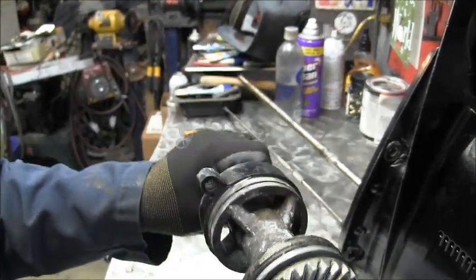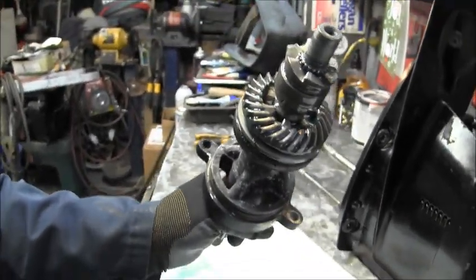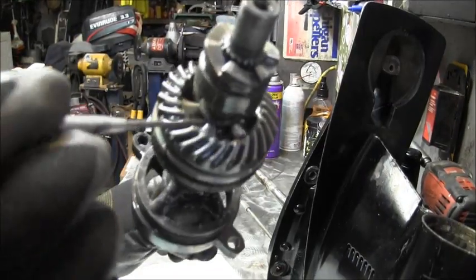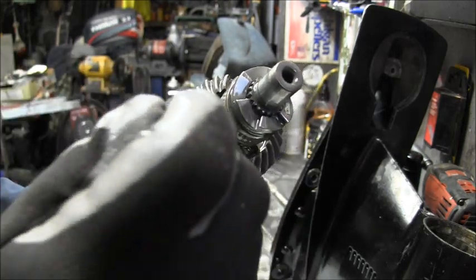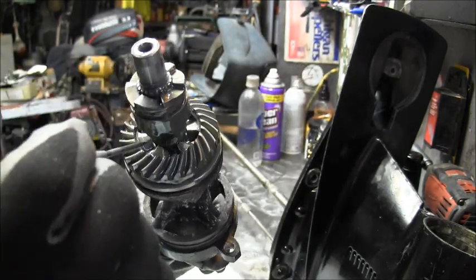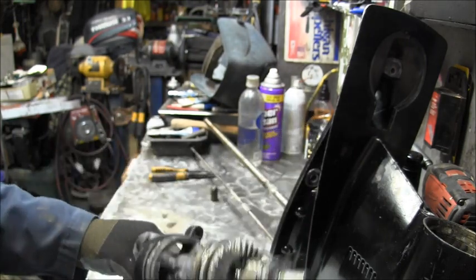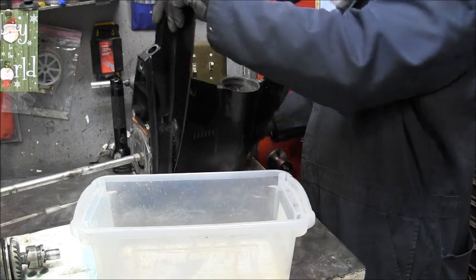especially on the clutch lugs. If you look here, let me get a pointy thing. I need a pointy thing. We got a point up in here. See, this is where those dog teeth are. They catch right there. Boom, and they look good. And so do these here. That's a good sign, especially if I slide this over that way.